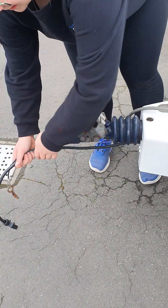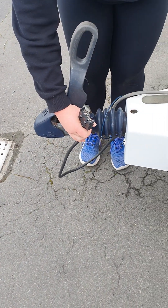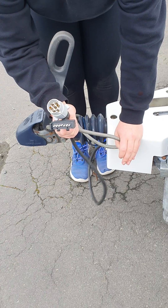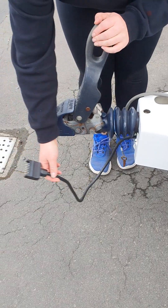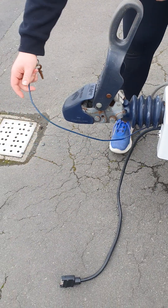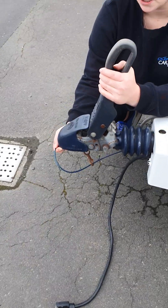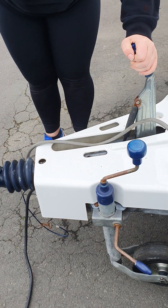You've got a standard seven-pin trailer plug here. You also have this additional auxiliary cord, so you can have an auto electrician wire those together for a 12-pin trailer plug to be able to run your fridge. This here is your breakaway cable, designed to loop around the tow ball and clip back onto itself. If the hitch ever gave way, the breakaway will snap off and put your handbrake on.